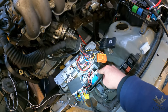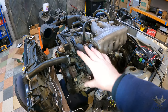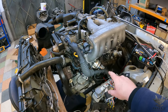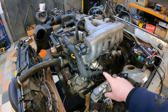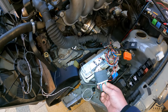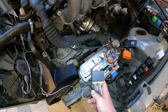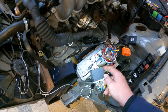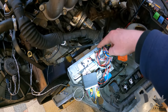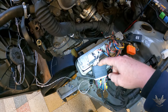It's just a junction box and it can clip in down here. First thing we're going to do is run through the entire layout — where everything is plugged in and where it goes. Starting in the ECU box, it's just your two plugs from a standard IS200 engine harness that should remain inside the vehicle when you remove the 1G FE engine. Then we've got the ECU itself, so we've got the three plugs that come from the engine harness.